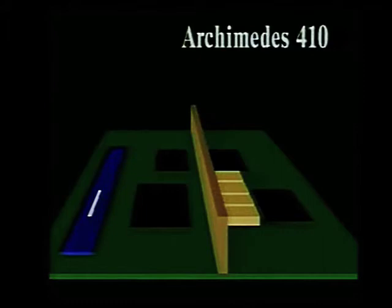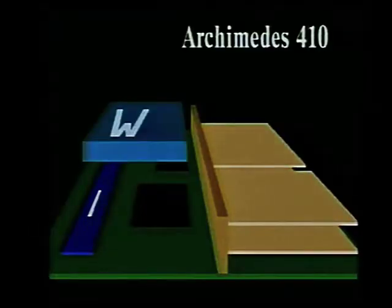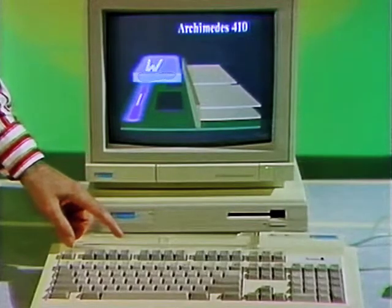There are also 2 machines in the Archimedes 400 series. Here's the first. The board is slightly different from before. This time, there's room for 4 modules and the backplane is already built in. And you'll notice it's full width. There are 2 and 4 modules. The Archimedes 410 here has got 1 megabyte of memory, but there's also the hardware to support an optional Winchester disk drive. And unlike the 300 series, one can fit a floating point arithmetic module. The most obvious external difference is the absence of red keys.